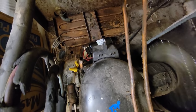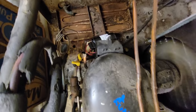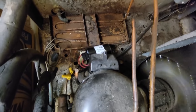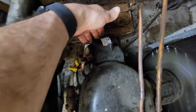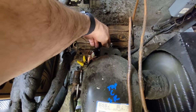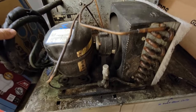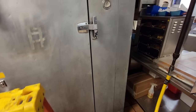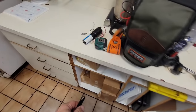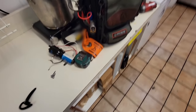Shady's back. I've got the compressor relay and stuff replaced - got the OEM ones in there. They didn't get me the exact capacitor and unfortunately there's no place to mount it and everything's broke here. So it's taped up - it's not the way I like it but I got it as good as I can. No one's going to get shocked on anything. I got the new factory OEM relay on there and the overload replaced. It is running and holding temperature even with that cheaper 3-in-1.